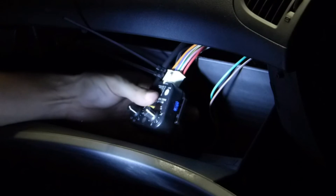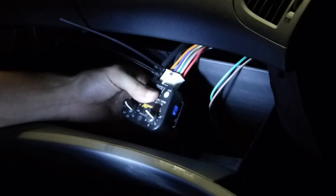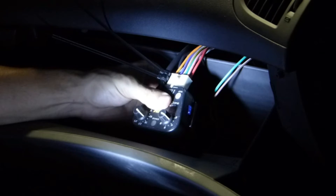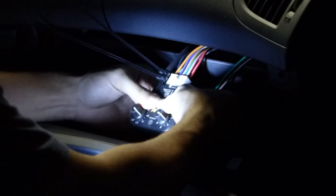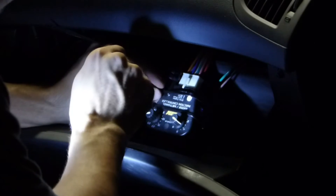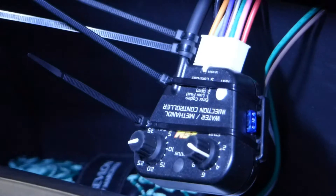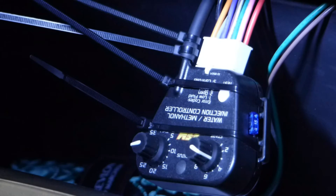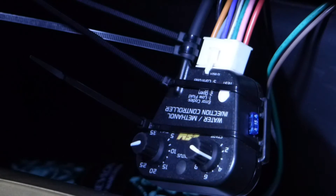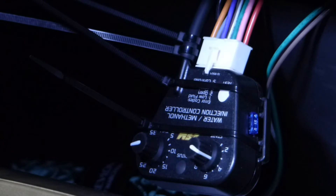It's not leaking — well, maybe it was leaking from there, but it's actually leaking inside the controller. Even though this is meant to go up to 35 PSI, it's leaking at like 25, 26 PSI. That stops the leak if I squeeze the entire controller. So that's how many zip ties I needed to keep that thing from exploding. It says it goes up to 35 PSI on the controller, but the controller itself physically cannot hold more than — I don't know — 10 PSI, or who knows what it's leaking at, but you've got to clamp the whole thing. Annoying.